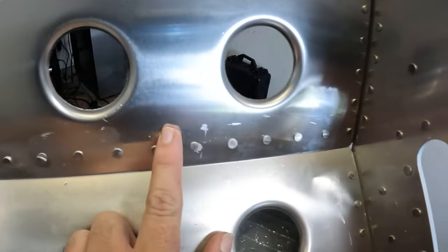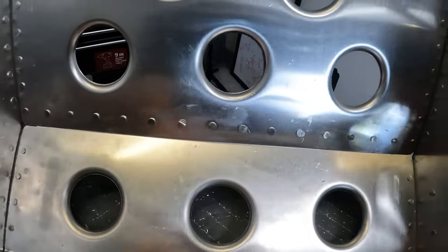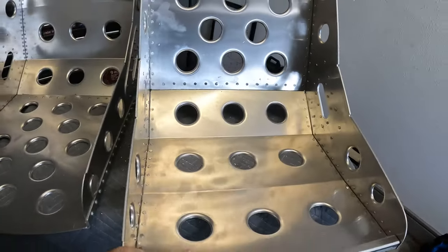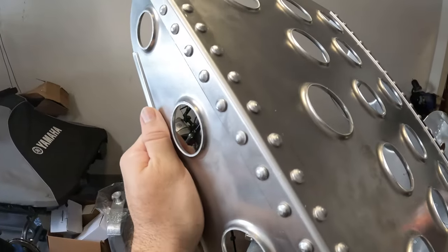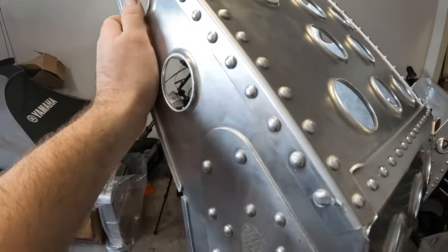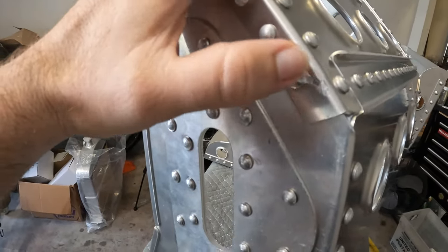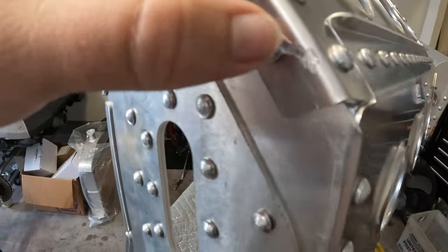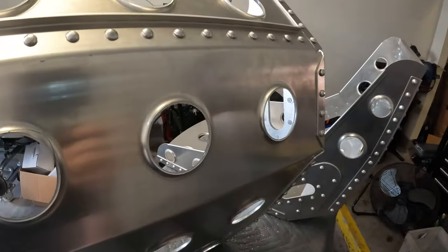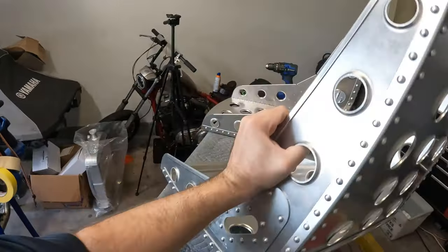And yeah, bucking bar marks here. So I did my best to keep it on track here. But again, it's got some flavor, character, I guess you could call it. Let's look at it now. It's not like you're going to actually see the back. And these rivets turned out pretty well, especially for the heads. And again, there's another area where the gun actually slipped right off the rivet itself and started, what was it called, crescent mooning there. But it looks really good. Pretty sure they're pretty uncomfortable. Let's drop them in the bucket and see how they look.